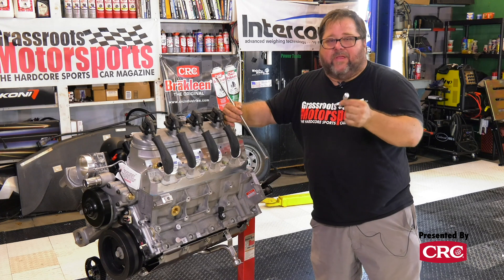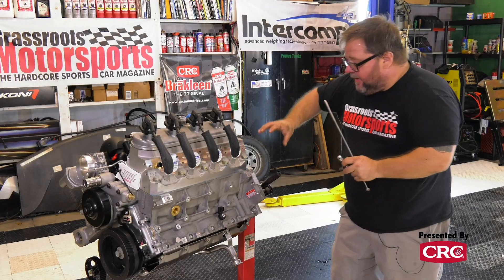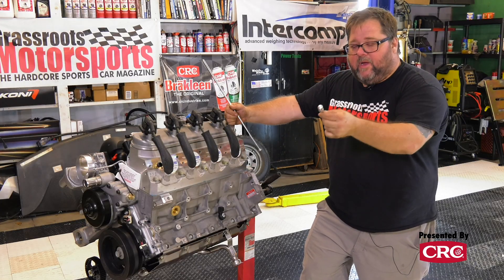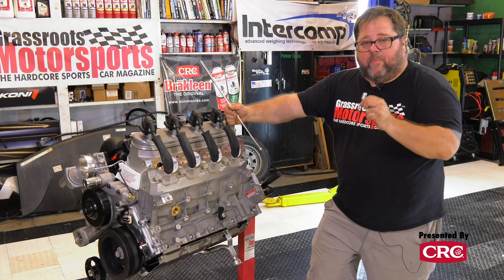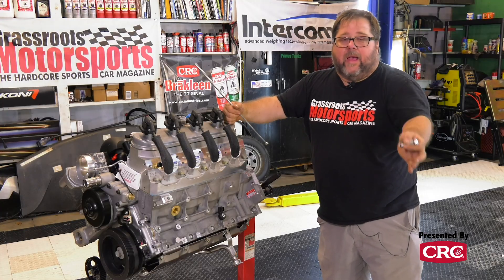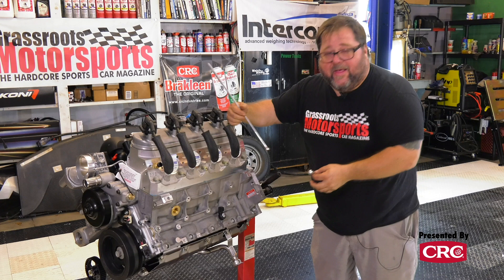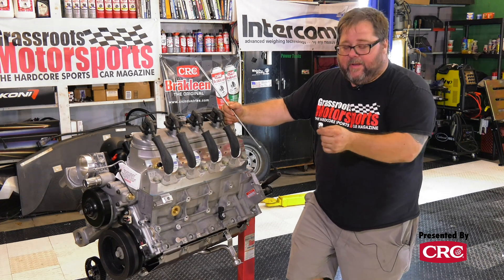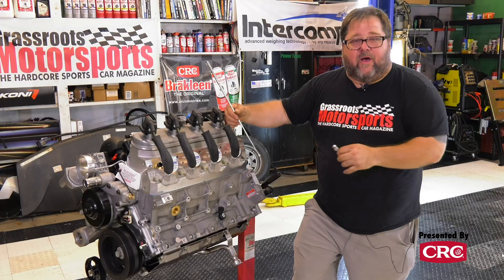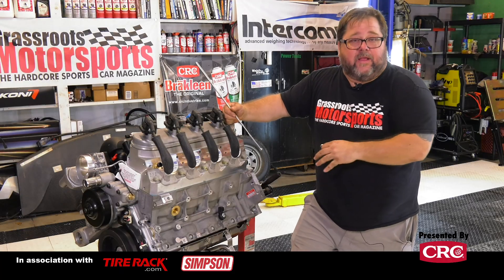And here's the best part — it's 26 bucks from Improved Racing. So if you are building an LS engine, if you're doing anything that causes you to take the rear cover off, a fantastic inexpensive reliability upgrade is to put a fresh dog bone in there. Replace your factory plastic dog bone with a nice machined dog bone from Improved Racing or any of a number of other suppliers. It's like 26 bucks plus shipping, and that is a very inexpensive mod to increase reliability. I can't tell you that radiusing these corners makes additional horsepower, but I know it doesn't hurt — it's something you should just do as a matter of course whenever you're building or going inside an LS engine to the point where you're taking the rear cover off.